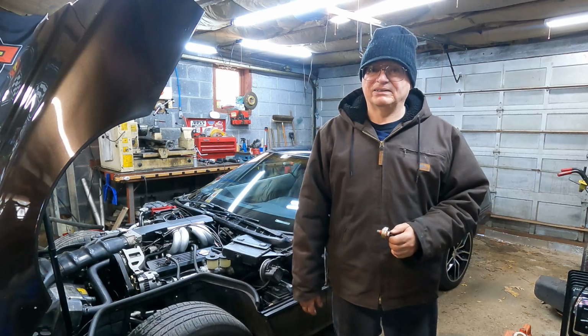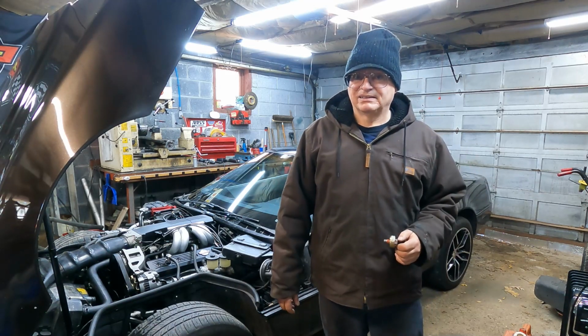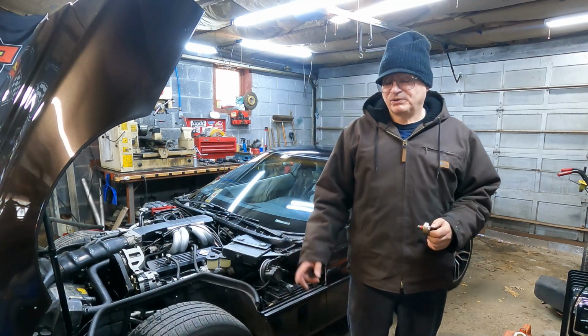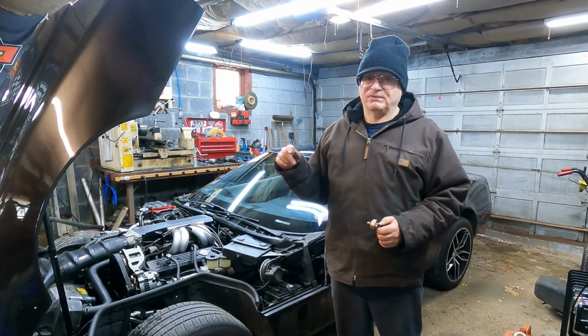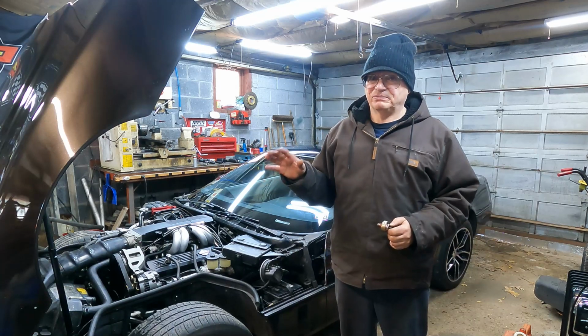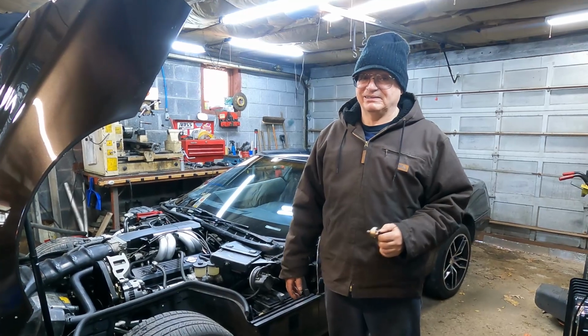All I can do is go out and road test it and data log and see how the rest of my knock counts are. When I did refresh this motor, I did go into the tune and back off the timing everywhere just to play it safe. I don't know. All I can do is data log and see what happens.